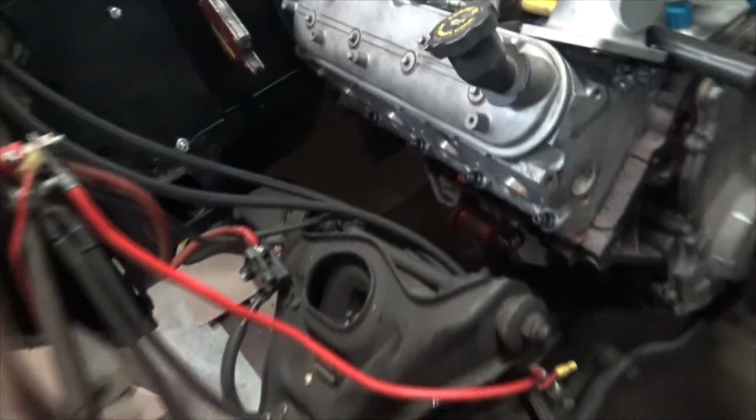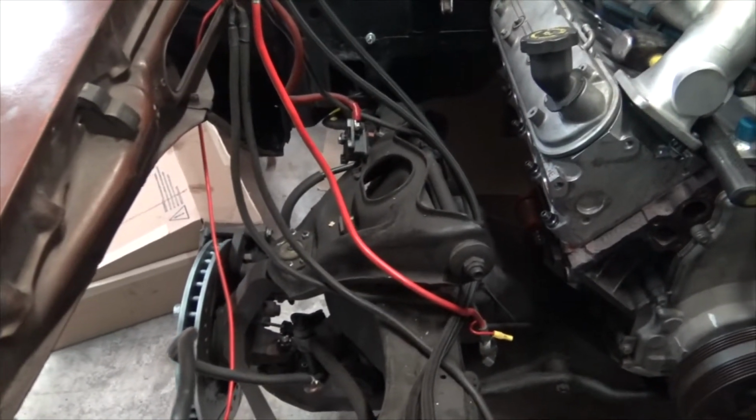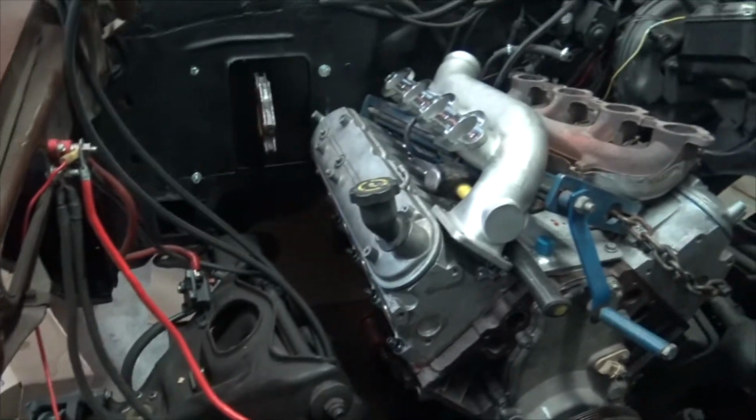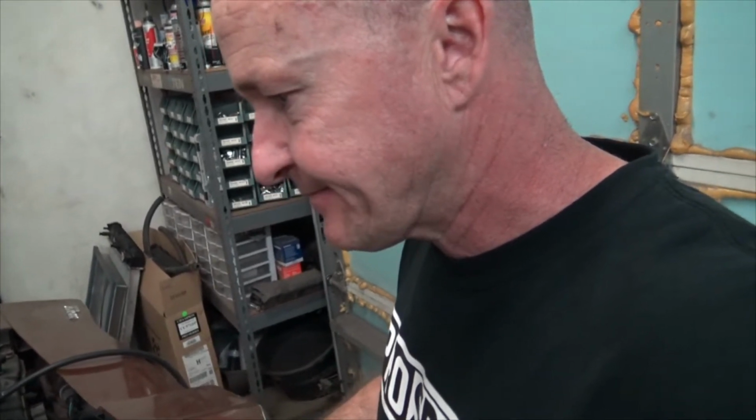So the very disappointing thing is this beautiful Fowler speed manifold isn't going to work. The shock tower, the upper A arm sits at this strange angle, almost a 20-degree angle like this. That comes in and hits right up against the manifold, which sucks because I really like cast manifolds. They're just strong and easy, and it was easy to get to the spark plugs. I don't really see any quick obvious way, but I'm just in that initial phase, I just found out it's screwed up. So if I think about it for a bunch of hours, then maybe I'll figure out a way to make it work. It doesn't look like it's going to work at all.